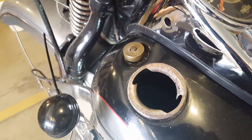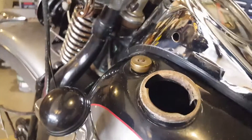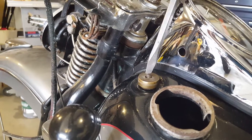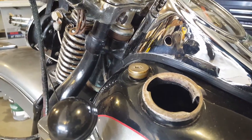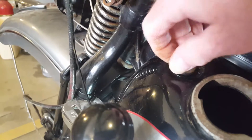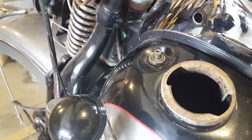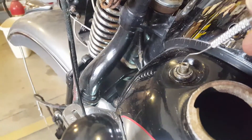Alright, we're going to learn how to remove the fuel shutoff rod that I've learned comes out the bottom. We'll remove the screw and the cap. Underneath there is a spring, and there is a small washer on top of the rubber.